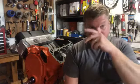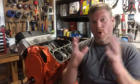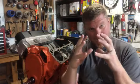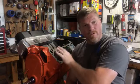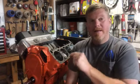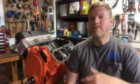Okay. So what? Typically, a supercharged engine has an intercooler. That intercooler is trying to shove in, as scientifically possible, as much cold, dense air as it can muster, because it's going through an intercooler, and it's trying to get those air molecules to calm down, not be so hot and active, but calm down and collect and condense, all right? So it's trying to shove in as much cool, condensed air and fuel as possible. What does that mean? That means that the intake charge is actually cooler on a supercharged engine than it is on a naturally aspirated engine, all right? The ambient air going into the intake manifold, into the cylinder head, is typically warmer on a naturally aspirated engine than on a supercharged engine.